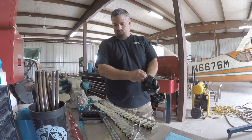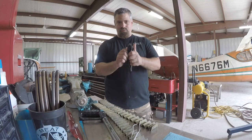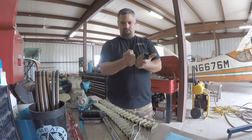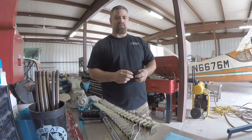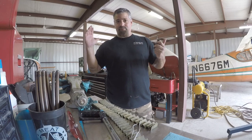This is how you properly check your oil filter when you cut it open. Don't just do the pleat trick — where you open it up and separate the pleats to try to see what's there. Oil is going to hide so much. You've got to squeeze that oil out of it and look at both sides. I hope this helps you, and as always, fly safe.